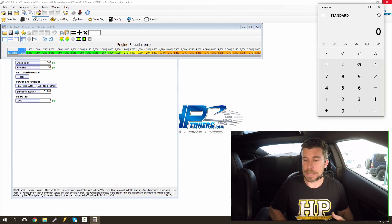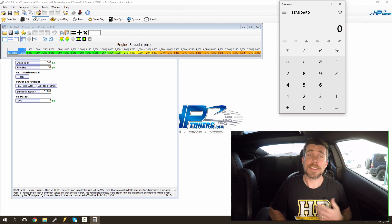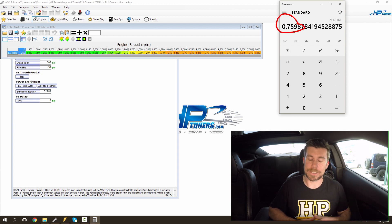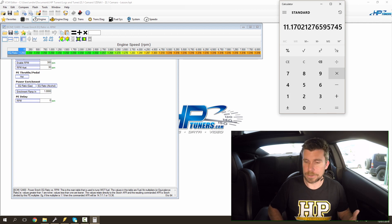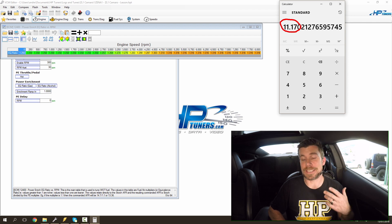I'm going to bring up my calculator so we can calculate the air fuel ratio as well as the lambda. The easiest way is to convert between equivalence ratio and lambda, as they're simply the inverse of each other. If I enter the equivalence ratio target of 1.316 and use the inverse function on my calculator, we're going to see what this equates to in terms of lambda values. We can see that this equates to 0.759, or let's call it 0.76 lambda. If we want to convert that into air fuel ratio values, we can simply multiply by the stoichiometric AFR — in this case for pump gas, 14.7 to 1. So we multiply by 14.7, and we can see that our target in air fuel ratio values is 11.17.